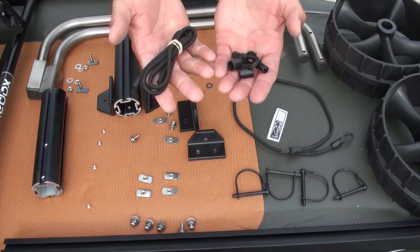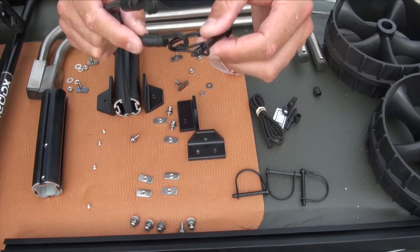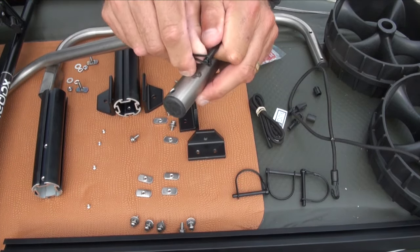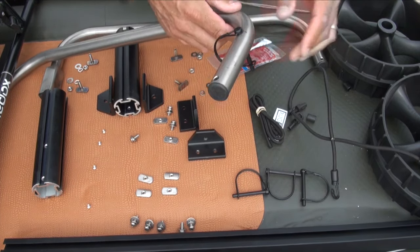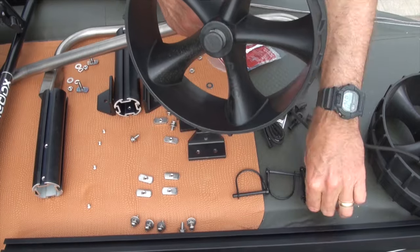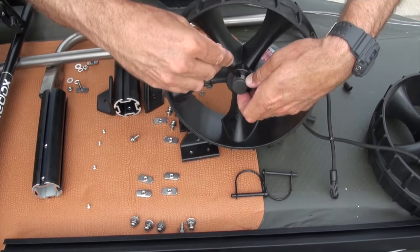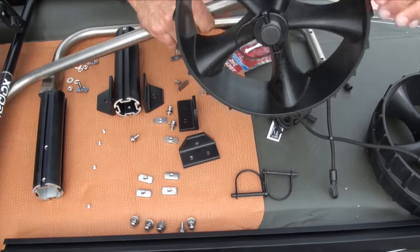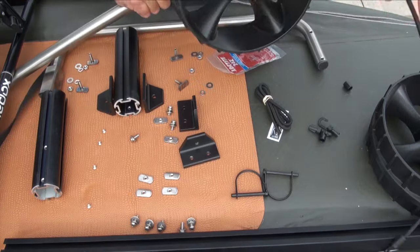The bungee hooks from one d-ring, and you get four of these clips that go into this part of the leg — they bookend where the wheel goes on. The wheel goes on like that, so the purpose of these clips is to secure the wheel on the bottom of the leg. Once you have two of those done, when this is in the stow position you need the bungee to hook from one side to the other to make sure the whole assembly doesn't rattle loose when you're driving down the road.